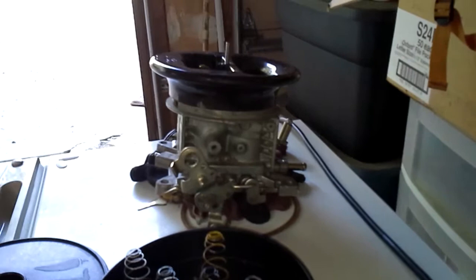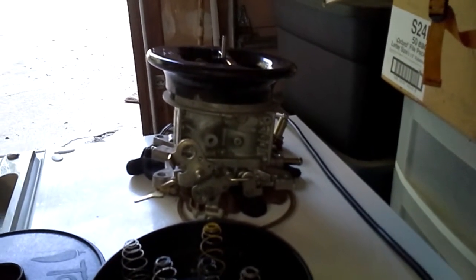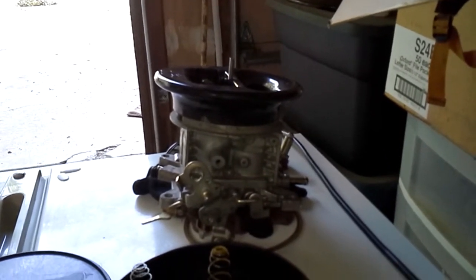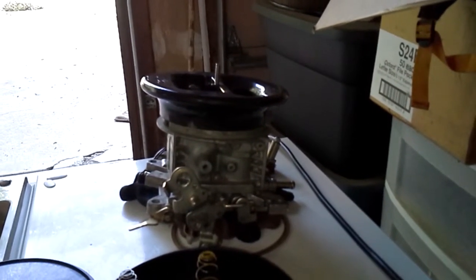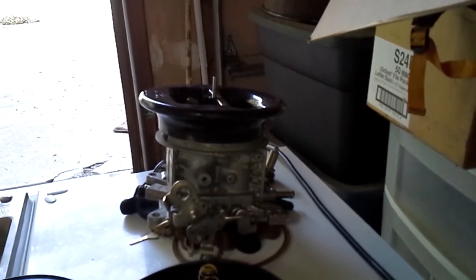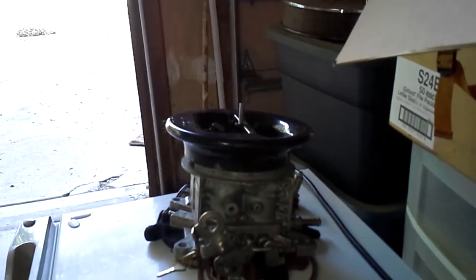So I took it out again last night and tried to do an acceleration test getting on the highway. Sure enough, it was popping and sputtering and acting up. So today I had a little extra time and I thought I'm going to pull that thing off and just see if that's possibly causing it. And sure enough, you pull that K&N stub stack off with that short 3-inch element and it goes back to running fine.